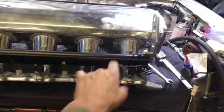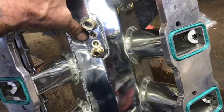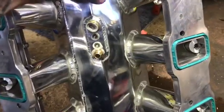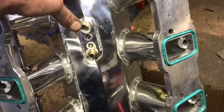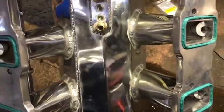The rails were on the money. Those two bolts are different because those are the ones that come with the throttle cable bracket. Now, let me flip this thing up, show you the bottom. Down here, it gave us a 3/8 hole and 3 1/8-inch MPT pipe thread. I really couldn't use an 1/8 inch. It's got to be bigger than that. So I put my intake air temp in the 3/8 here, this one. I put 2 plugs there, and then I drilled and tapped that one to be 3/8. It's quarter pipe thread, but a 3/8 barb on it. See? Now, I put that down.